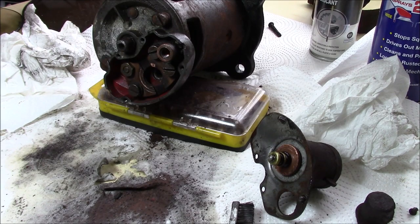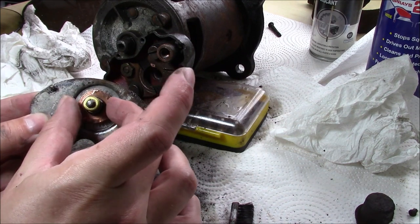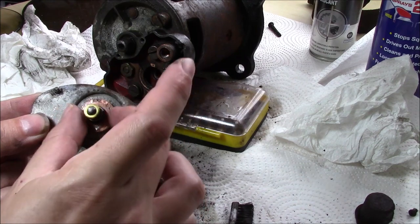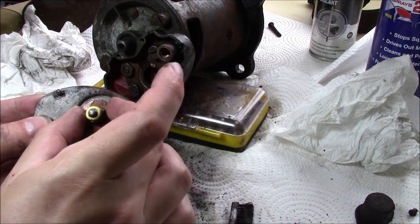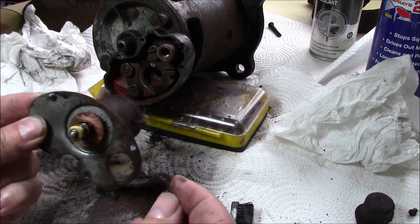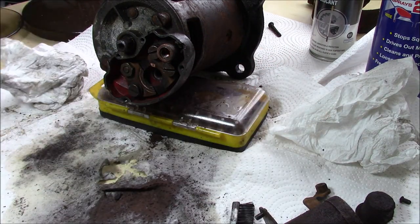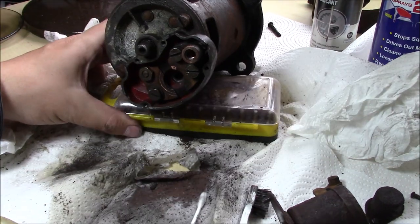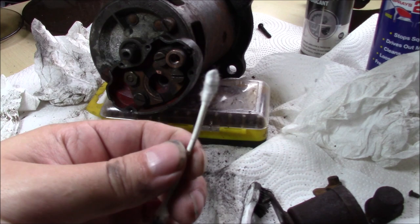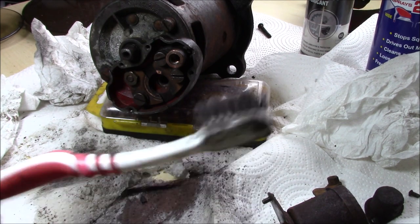I'll do this until the heaviest deposits are cleared, and once I've got all the really heavy deposits off, I'll finish off with the cotton bud just to get any stubborn last bits. With the commutator all cleaned up, I'll show you that in a moment. Turning my attention to this side of the switch. One interesting thing I noticed is before I cleaned this, this disc didn't move at all. As I cleaned all the corrosion and dirt off here, the disc just started spinning very freely, so hopefully that will help as well. I assume that means that when it starts and disengages, this disc sometimes can just move around so you don't burn one particular point out on the contact. I'm guessing on that one.